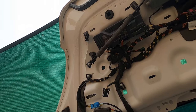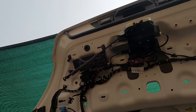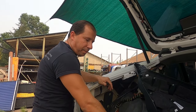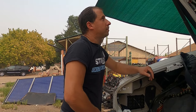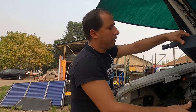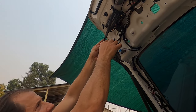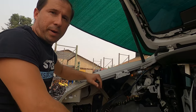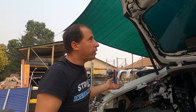You can reuse it. Basically, if your battery is low and you want to open the trunk, instead of going through the whole process of plugging in the battery — your battery is located in the back, so how do you access it? We've done it the hard way in our first videos. You don't have to do all that. Just climb to the back seats, remove the light panel, pull this cable out, and your trunk is open. Then you have access to the battery.